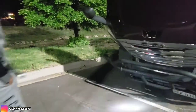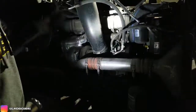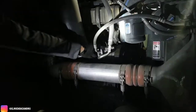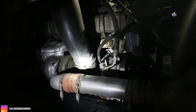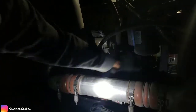In the engine compartment, first we're gonna check there's no leak under the truck, and we're gonna check general hoses — properly secured, both ends, no abrasion, no cuts, not leaking. We're gonna check the belt-driven alternator: properly secured, no cracks, no broken wires, wires are connected. The belt is not cracked, and the free play for the belt is half to three-quarters of an inch.